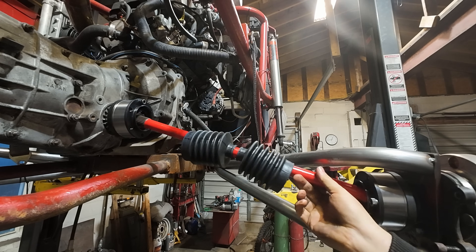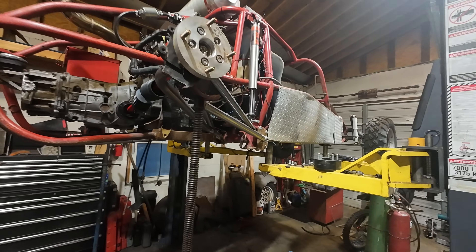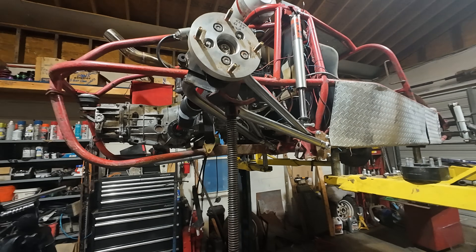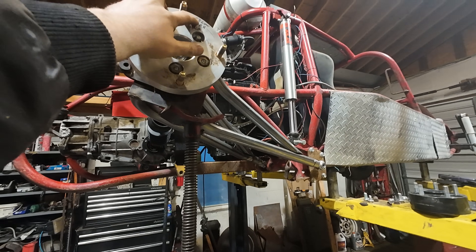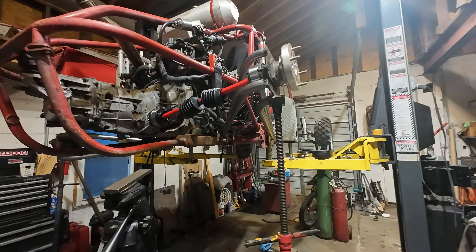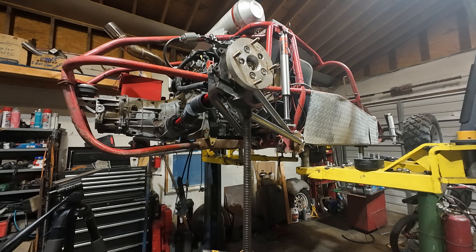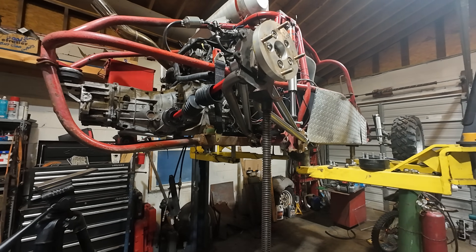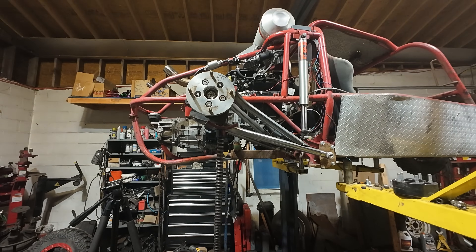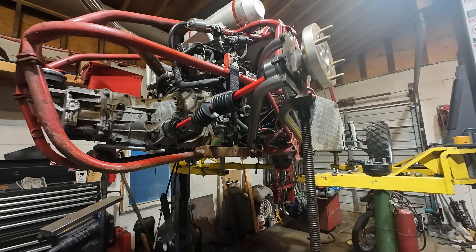We have tons of plunge and look very good — we won't run out of angle in compression at all. Nice and floppy. At full bump, that gives me three inches from my frame rail to the ground, so ideally you'd be hitting the bump stop rather than slapping the frame rails on the ground. I'm seeing between 62 at full droop and 78 at full high — that's 16 inches of travel. I'd like a smidge more, but without moving the transmission down we can only droop four to five inches below ride height. You can always lower the trans another time and still retain the same axle length.